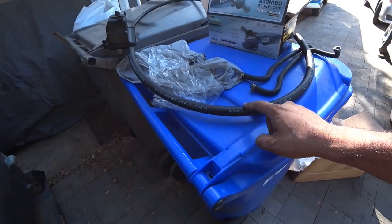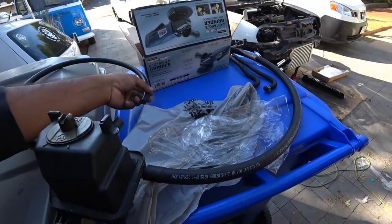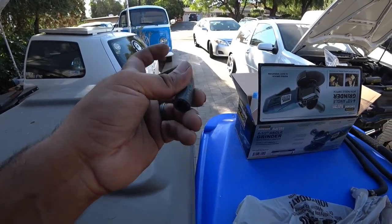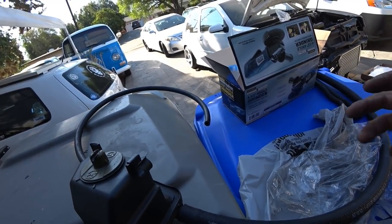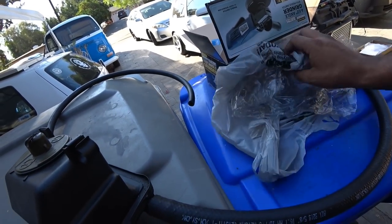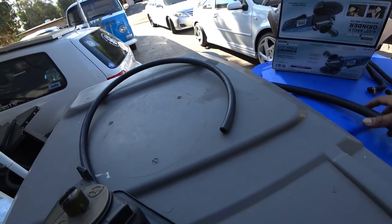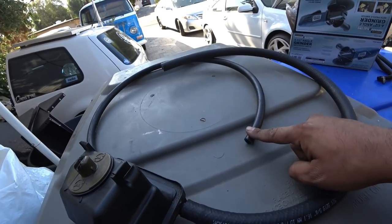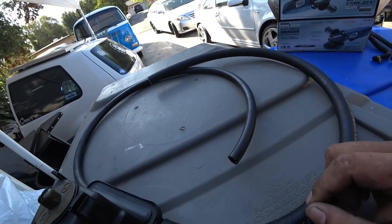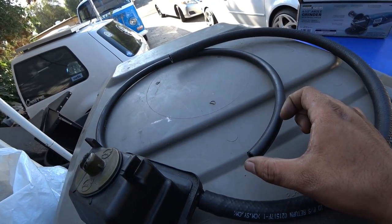First we're going to finish up the DIY on the power steering. For your power steering hose, you're going to need the 5/8ths power steering return line and 3/8ths power steering return line. These are very special hoses used for power steering fluid — they have a special liner inside so they don't leak and don't get loose with heat and moisture. When you use a cheap PVC hose or heater hose, the hose gets super floppy and loose and ends up leaking. This is your foundation for your relocation. We're going to run this line over that metal pipe — use a little grease on the actual pipe so this can slide on at least a good 2 inches back.